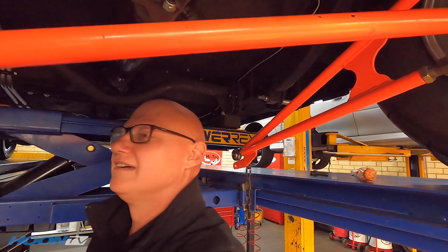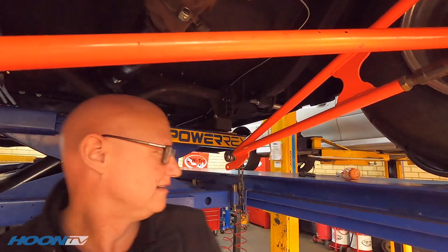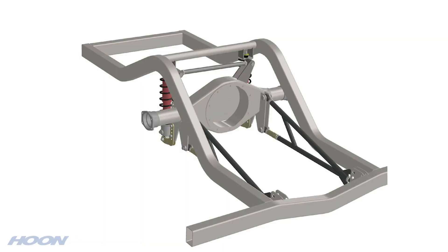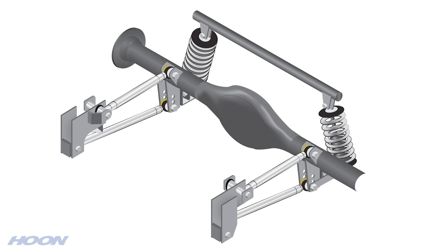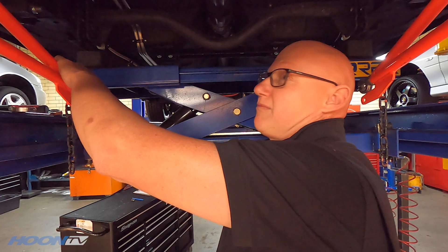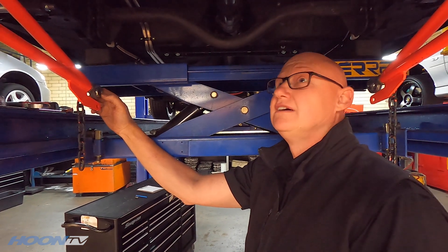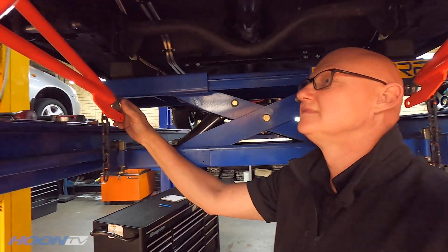So explain the difference between a ladder bar and a four-link. A ladder bar is a basic setup in the rear of the car. They were used back in the day for safe spacing against the floor. It's not the perfect system - a four-link is obviously a lot better; you can project instant centres and move things around much more precisely. But ladder bars are a little cruder yet actually work quite well. I've never had a problem with a ladder bar rear car. They hit the tyres a little bit harder than a four-link, but it'll work well on this thing.